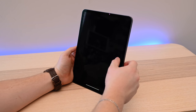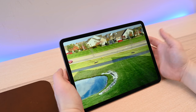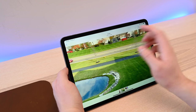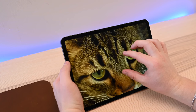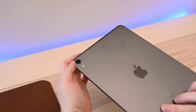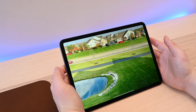All of these new cameras are a lot better than they were before, even if the resolutions seem pretty similar. That front-facing camera got redesigned as part of the Face ID and TrueDepth camera system, whereas the back camera got completely overhauled as well. Pictures look a lot more vibrant, most likely due to deeper pixels like we saw with the iPhone XS and XS Max. Apple didn't give a lot of details on what changed other than a redesigned camera, but photos instantly look better. A couple of things we do know: the beefed-up processors now let you shoot 4K video at 60 frames per second, and there's a new five-element lens instead of the old six-element. Unfortunately, optical image stabilization was stripped out, so hopefully the new digital stabilization will work just as well.